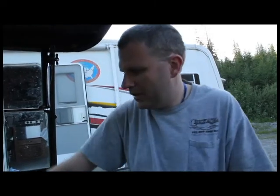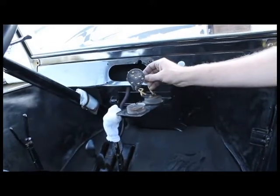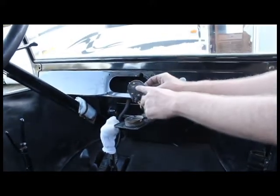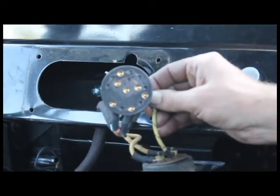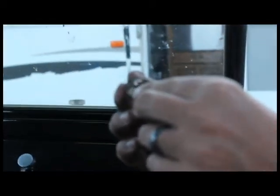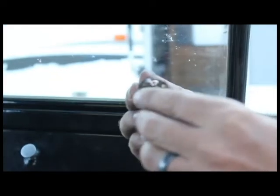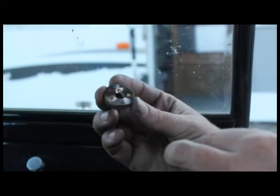Okay, so the switch wasn't working. What happened? After we pulled it apart, we took a look on the underside of the backing plate and found that the contact was missing the dead center of the connection point. So we took the connector out, gave it another bend, and cleaned all the gunk off the connecting surfaces, put it back together, and it fired right up.